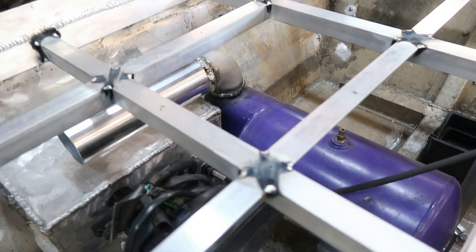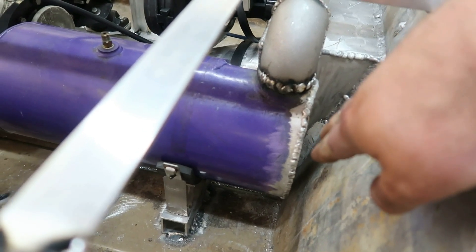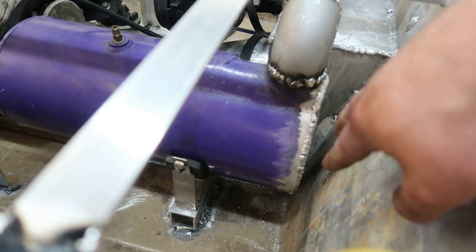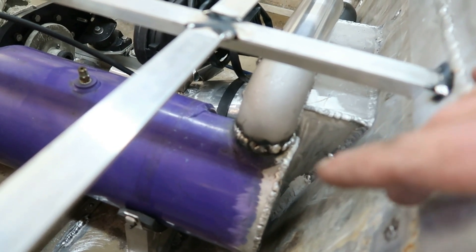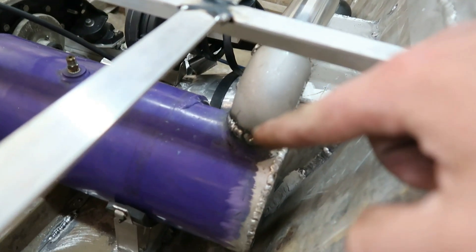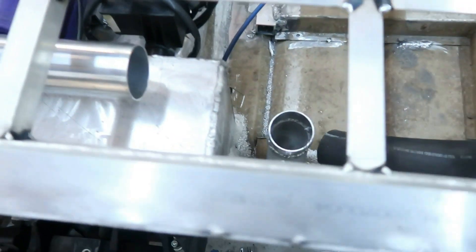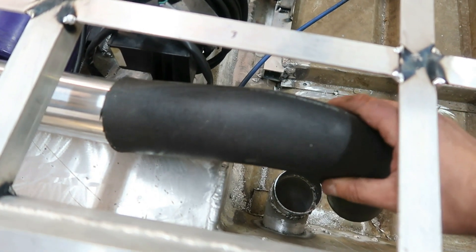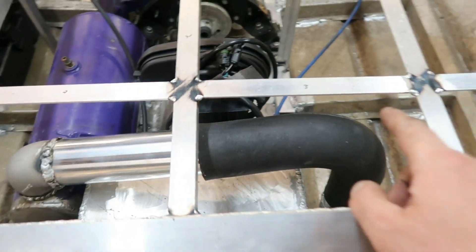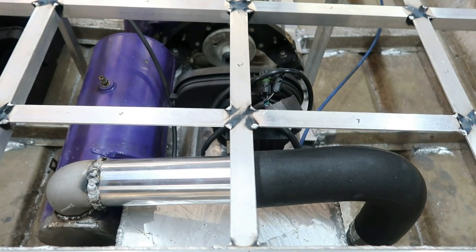Looking at the exhaust — that muffler wouldn't clear, so I had to cut off the back end of it, about two inches, and then re-weld a cap on so it could fit down in there. From the purple muffler to the exit out of the boat, the OEM setup was all rubber, but this exhaust pipe you see there is aluminum now. I ordered a few tight-bend radiuses and welded some tubing. There's the port that it comes out. The factory hose actually stuck up all weird and would have been about eight inches above my deck boards.